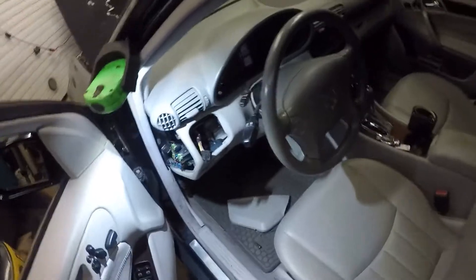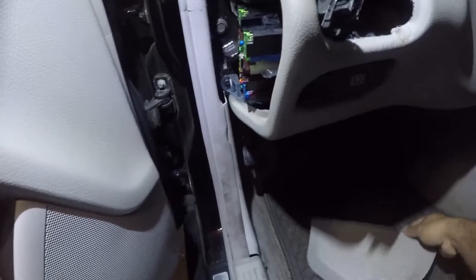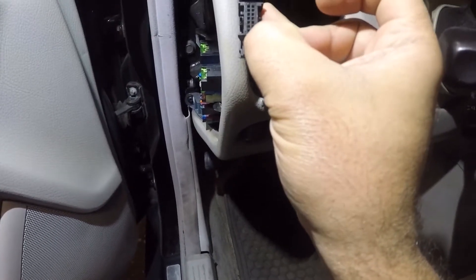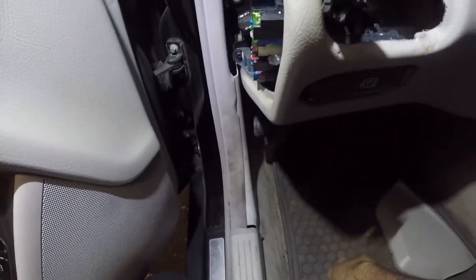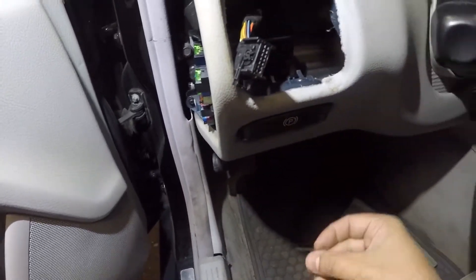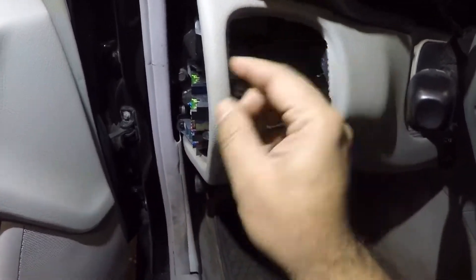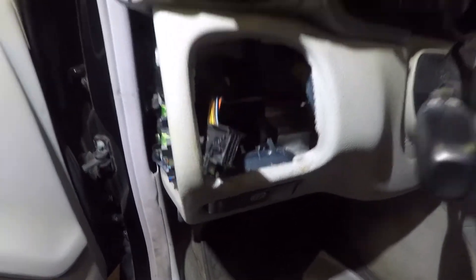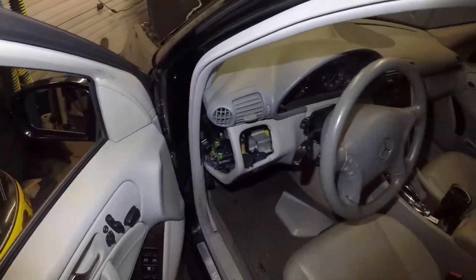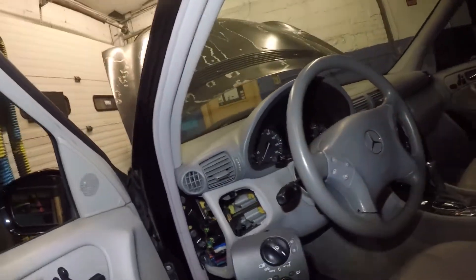I've been working on this for about 30 to 40 minutes. I used the cotter pin here — the broken pins, I got them out. I used a pick to pry them out little by little. You could also push the pin all the way through and it will fall out in the back somewhere, which doesn't cause any harm. Now it's time for this switch to go in.